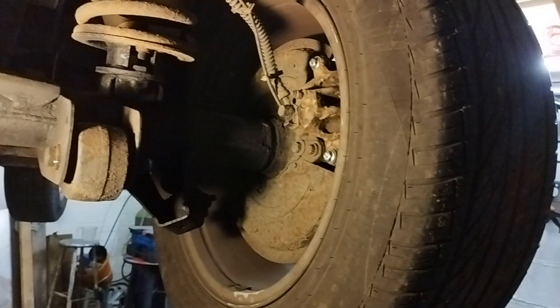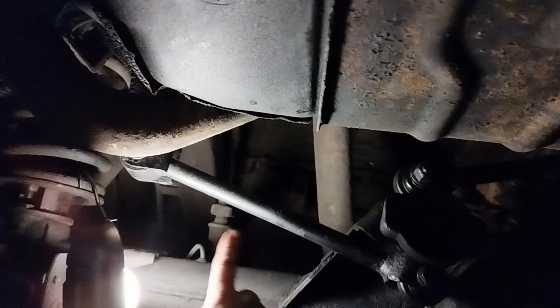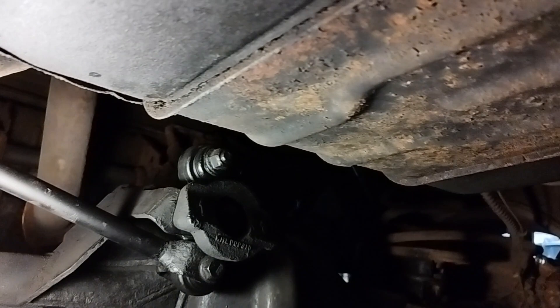Check your brakes — you can check them from outside. They tend to have rotted out. Check them on the face of the discs. You can see your suspension components from under the car. Check for bump stops — there should be two black bump stops. Also check your anti-roll bar bushes — make sure they're not perished. You can see these are the new ones we've just put on. Make sure they look like that and aren't perished.